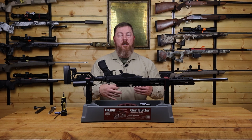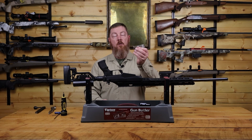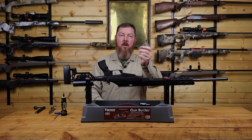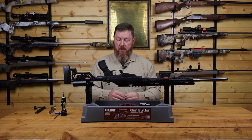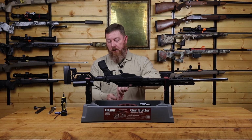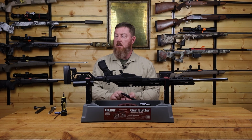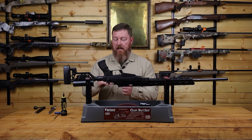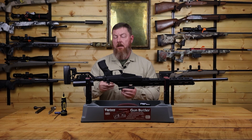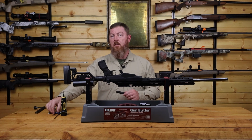So inside your bag rider bag, you'll have your bag rider, and you'll have new mounting hardware. And these are 3mm cap screws. So we'll take our cap screws. If you're wanting to torque this on or put some Loctite on here, you definitely can. You would torque these to between 25 and 35 inch-pounds. We're just going to do these dry.